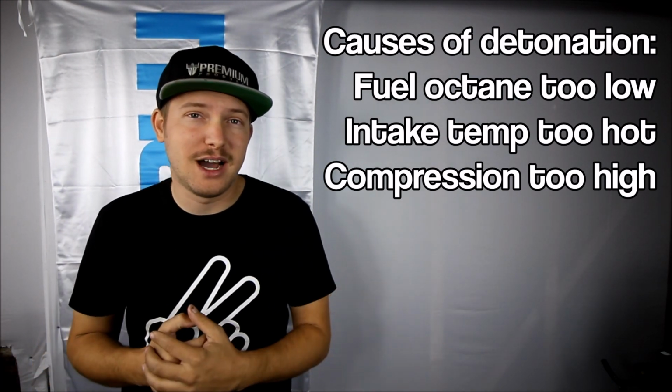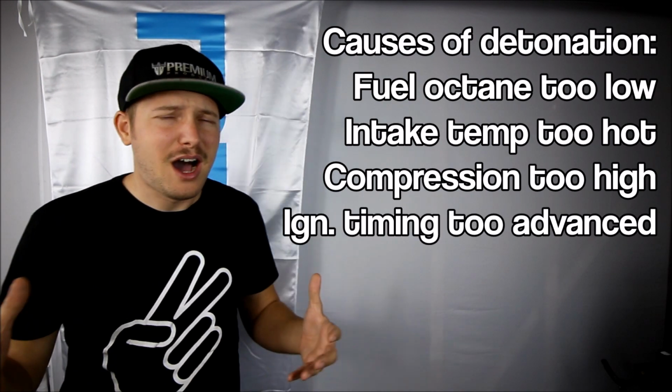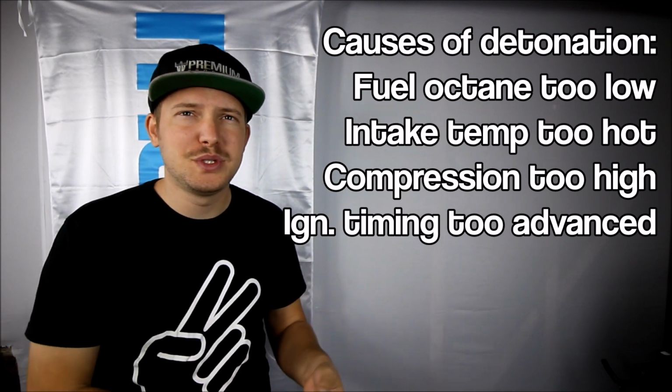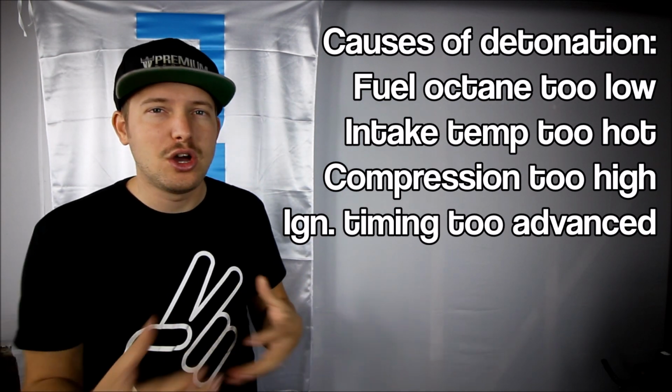And that's another thing that causes knock, is too aggressive ignition advance. Basically, the optimal ignition advance is different depending on how much throttle you're using, how much boost is going through the engine, what RPM you're at. It changes all the time. A lot of people with stock Miatas advance their ignition a few degrees, and it can be worth a few horsepower, but you are kind of doing guesswork without a dyno or something that can listen for detonation.